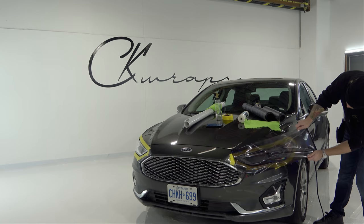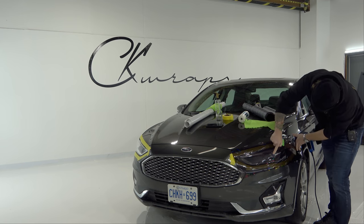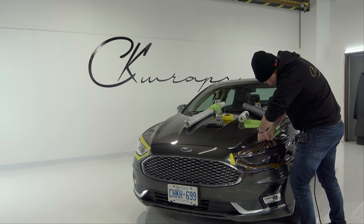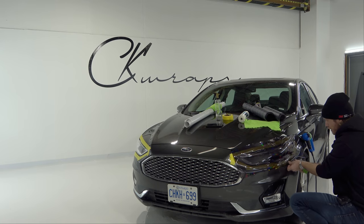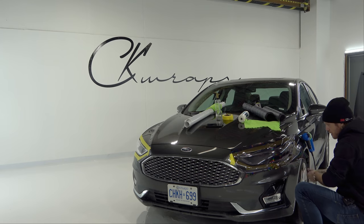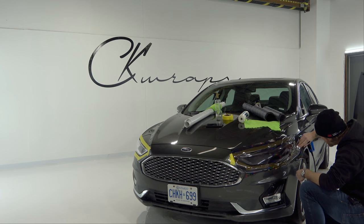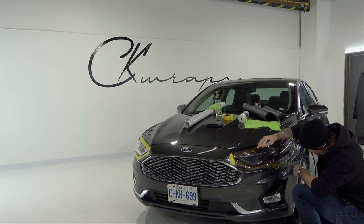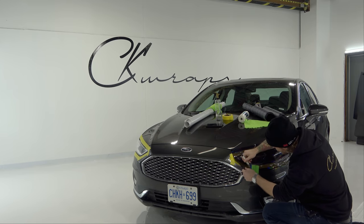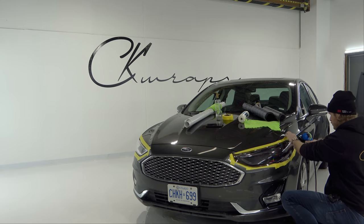Make sure you don't put your hands behind the film — it will leave fingerprints on it. I'm going to pull out some of these wrinkles without putting my hands behind where I'm wrapping. That's all good. Now what we're going to do is cut on the masking tape, and this is what I'm going to tell you about alleviating tension around the edges — cutting on the masking tape to make sure we can separate all of this and then shrink it down around the edges.